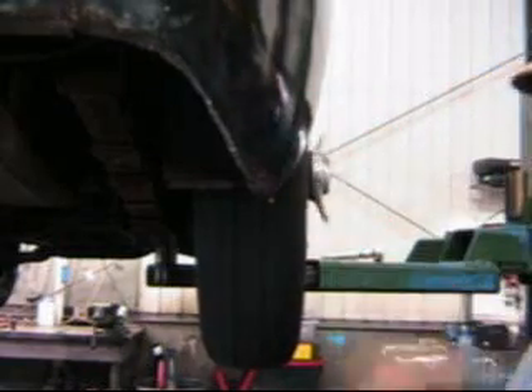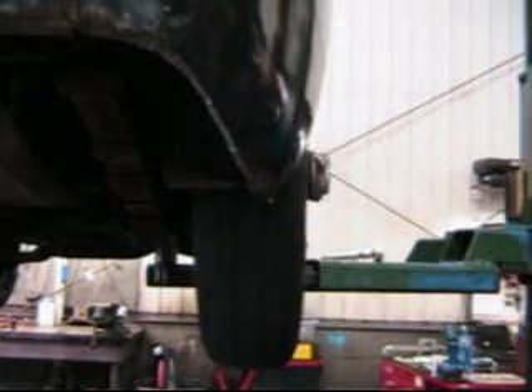So all five of these tires. We've got another 30 cars here in the shop — that makes 30 times 4, which is 120 tires. The point is that all the rims are bent now to some degree or another. No rim is perfect to start off with. So before you admonish your tire balancer or get mad about your tires, make sure that your rims are straight. The problem with steel rims is there are very few places that can straighten a disc wheel. And wire wheels — you can take a spoke wrench and tighten all you want, but there's not much you can do to get them straight.